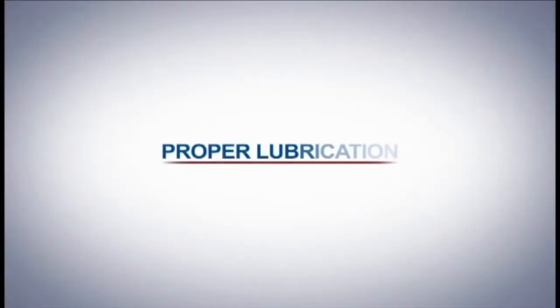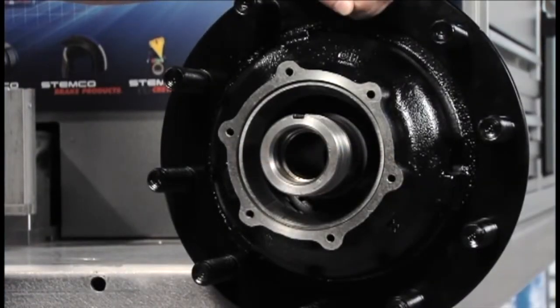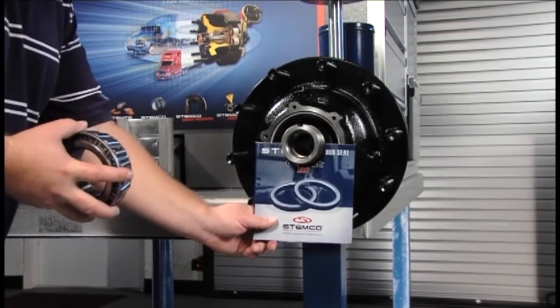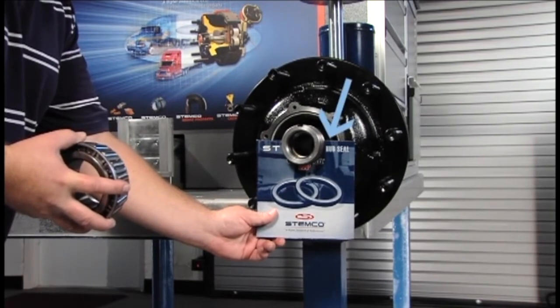As we button up the wheel end, we look at the use of oil and grease. Today, oil is the most frequently used lubrication in wheel ends. In any of the seal applications that a fleet may use, the hub reservoir is often partially filled just before the outer bearing is put in place. This reduces the amount of oil that has to seep through the outer bearing to fill the reservoir and bring the oil to its proper level. The same may be done with semi-fluid grease, using a template to hold the grease in place.